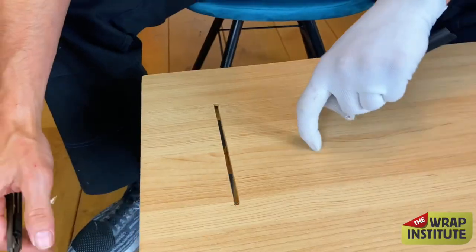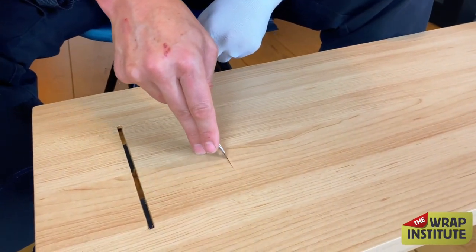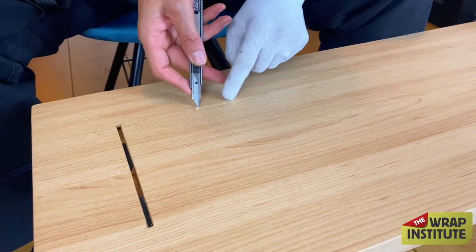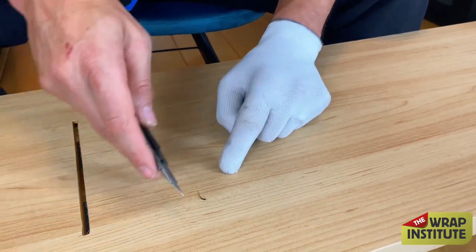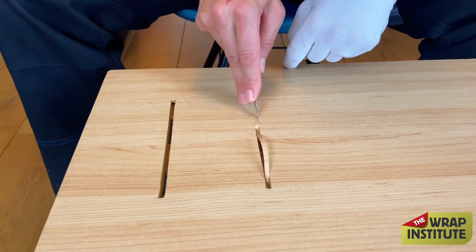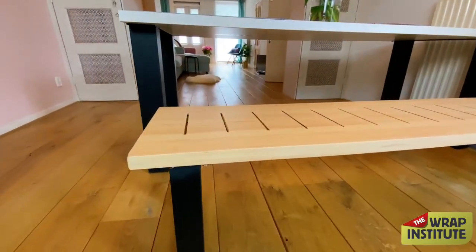The final stage is cutting out the little gaps in the slats. Use a super sharp blade, set it up with a finger in the application glove, and do a slight beveled away cut so it lays flush on the surface. Hook the ends — start on the long point, hook the ends, then finish with the long run on the other side. The thickness of the film holds the material off the surface, so as long as you get the angle right it goes super smooth.